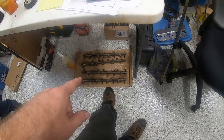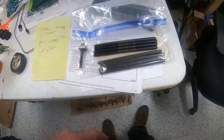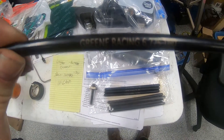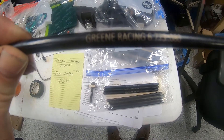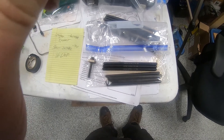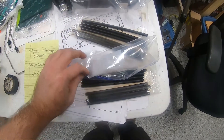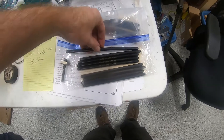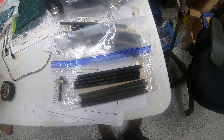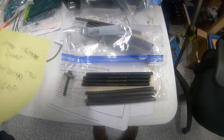We're going to go ahead and get the valve actuator arms in place. You can see these are hardened push rods — they came from my tuner, hence why they've got his name and numbers stamped on them. We've got a longer set and a shorter set, pretty much standard Hemi setup. The shorter rods go to the intake side and the longer rods go to the exhaust side.